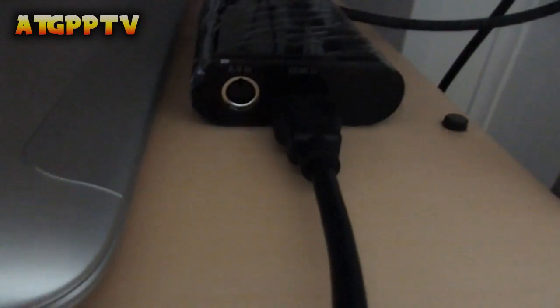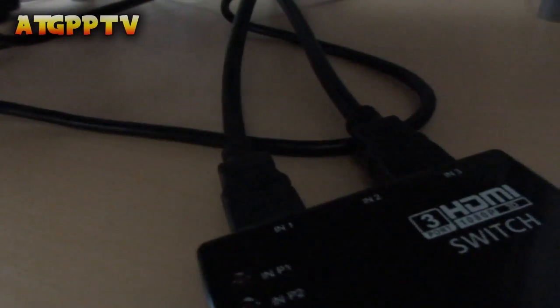Small overview from the beginning again: the Elgato from the HDMI in goes into the output section for your HDMI splitter. For the input section of your HDMI switch, you plug in all your consoles. From the output section, plug that into the back of the monitor. There you guys have the whole how-to video.